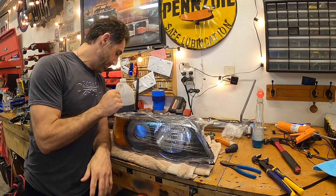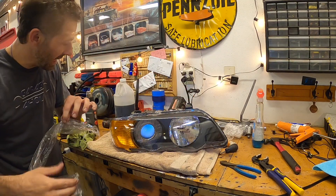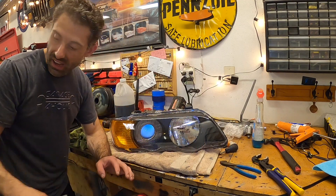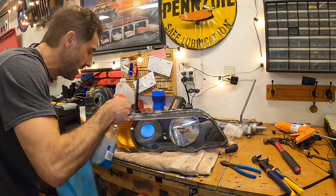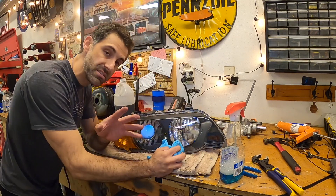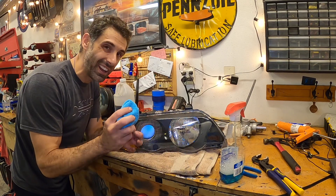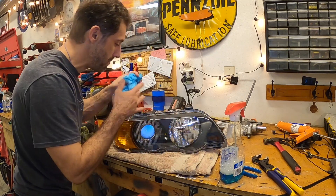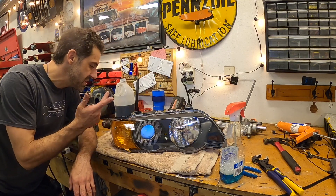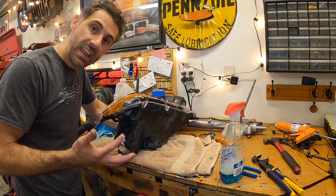I got all the clips to click, and now I can take off the plastic. I'm really glad I kept the plastic on because I would have made fingerprints of Permatex all throughout this entire thing. So that's garbage. Probably want to clean up a little bit here on the top where I did get some — you've got to do it quickly before it dries. Today is a really hot day, so the Permatex is going to start to vulcanize probably within about 10 minutes, so you do have to keep that in mind. Then you just take the excess and kind of stick it around where it needs to go.